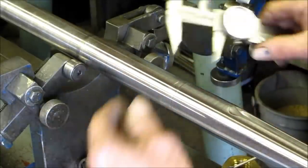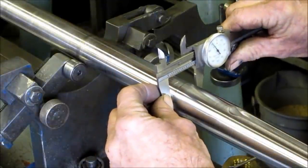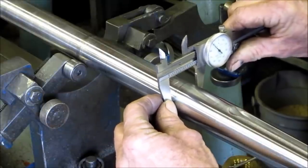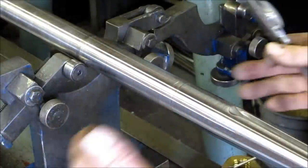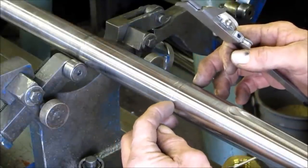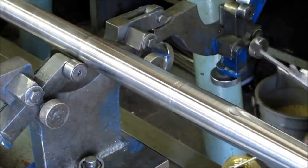So if it was one inch, it'd be 20 thousandths. This one right here is an inch and a half, so we're talking 30 thousandths. This one little groove, little area right here, is less than halfway to what I would consider considerable, and it's only in that little tiny area. We polish on over here — it's got a lot of life left.